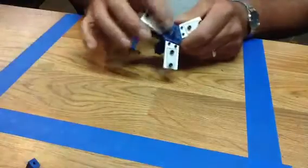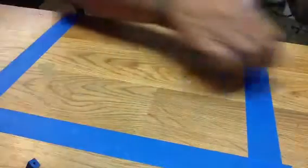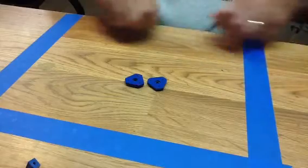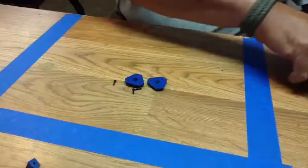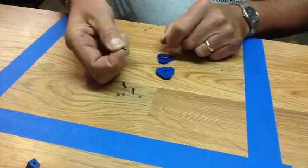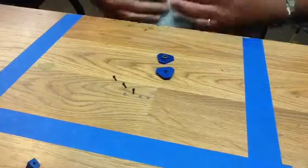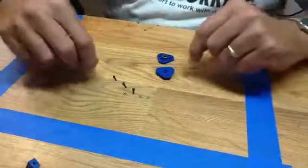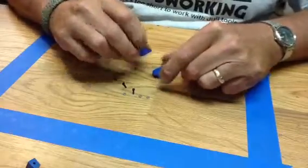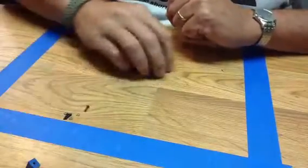After we take this off, we have to dismantle this piece and save the centerpiece here. Now the centerpiece is in two halves. It's a bearing holder, I should say. It has an upper and lower bearing molded in. It comes together with 3 little screws and 3 little nuts. You see how small they are next to my fat fingers. So I suggest you work with your belly up to the table here, because they're going to go flying and you're never going to find them on the concrete floor. Trust me, been there, done that, got the t-shirt. After we take this apart and save all the bolts and nuts, we'll put this aside.